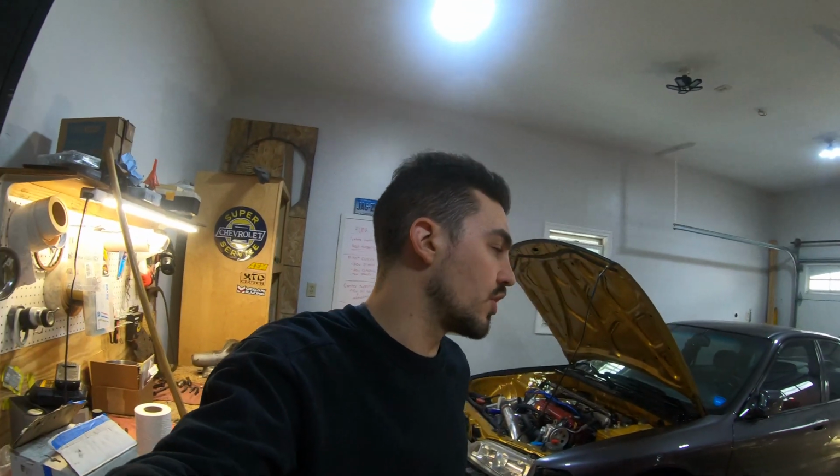As long as I take the lightest 2, or the ones that are the least bent, I think I'll be satisfied with the vibration, because I think it's pretty okay right now without the wheel spacers. So if I can get 2 decent ones, I think it'll minimize vibration and tire wear in the back, and I should be fine. I'm going to leave the bearings alone because they don't look shot. They're not bent that much, like, I don't know, 13 thousandths isn't bad. The spec's 5 thousandths, but I doubt you'd even feel anything up to like 8 or 9. I think 13, you might start to feel that. And the other side we're going to check.